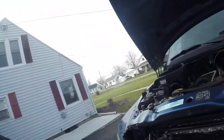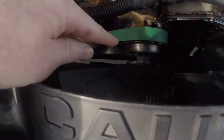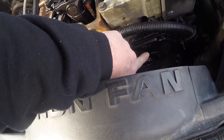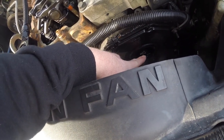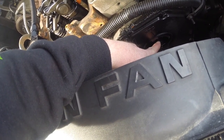You do need to have your motor at top dead center. To get the motor at top dead center, some engines have a mark on the harmonic balancer that you can check, but you've got to make sure you're on the right stroke. To verify that, if you take your crankcase breather off, there's a mark right here that says TDC — top dead center — and then on your VP44 gear, VE gear, CP3 gear, whatever it may be, there'll be a mark on that gear also.